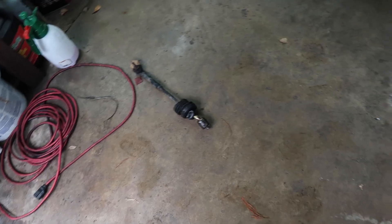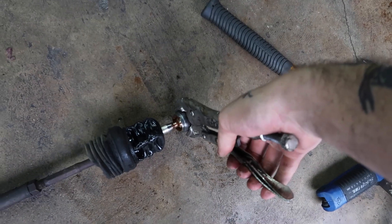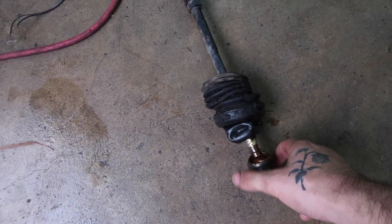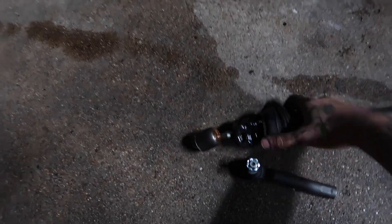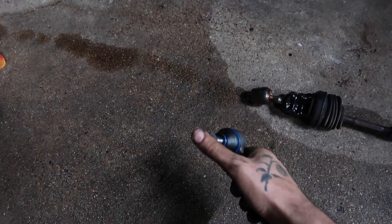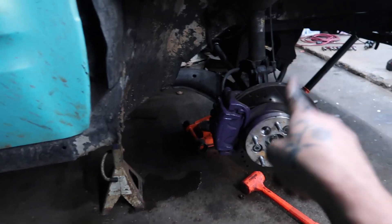The outer one wasn't too bad — you still don't want to be able to move it this easy — but these inners were definitely shot. Got the two inner and outers off. I just used vice grips, literally clamped them on and I'm able to pop them loose. You can see this inner is extremely messed up, and this inner extremely messed up as well. I just finally received my new inner and outers — I cannot even push this one sideways, whereas this guy just flops and spins around. Same with the outer tie rod. I'm going to set everything out and try to get it to be the same length so it's easier to align.